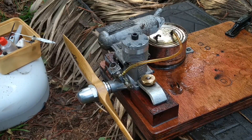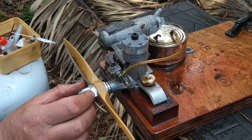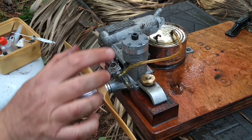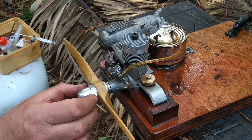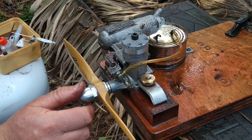I've never run either before — I haven't run this as a glow or as a diesel, and I've never run the Davis diesel head before. It needed a little modification to make it fit as it's a slightly oversized unit, and it's taken a long time to get it going. It turns out the compression screw has to be wound almost all the way in for it to work, but work it does. There's not much gas left but we'll give it a go.